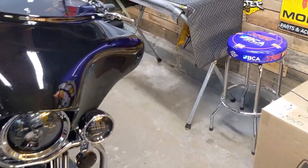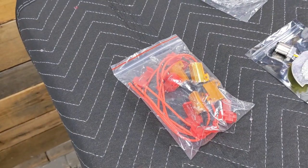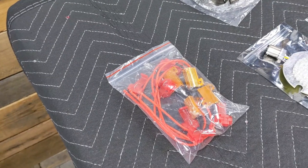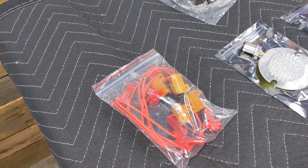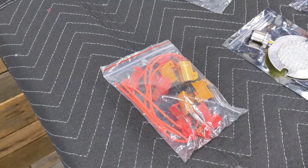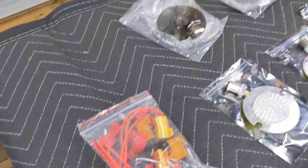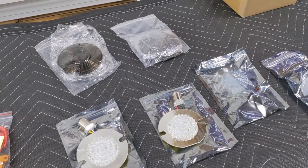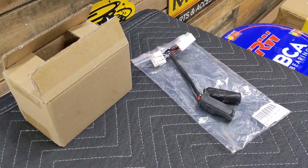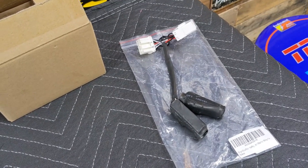In order to fix that you need to install a load resistor. Usually when you buy some of these LED kits they come with load resistors — if you've ever done HIDs in a car you know all this stuff. But I wasn't keen on cutting into all my wires. I'm not a big fan of scotch locks because they tend to cause corrosion and I've had wiring fail because of them in the past. There are load resistors you can buy that are already pre-assembled, plug-and-play. Badlands makes a few different ones, and there are a bunch on Amazon and eBay.